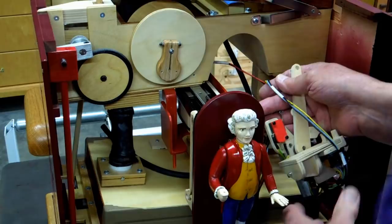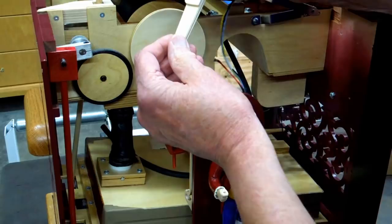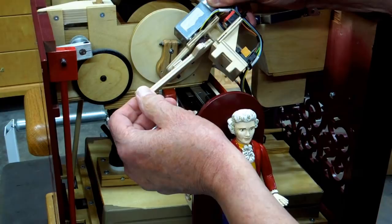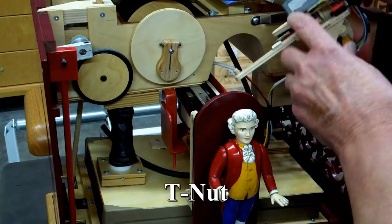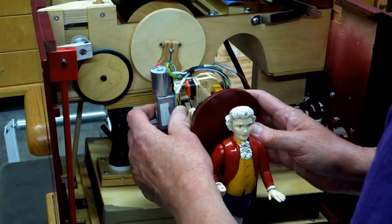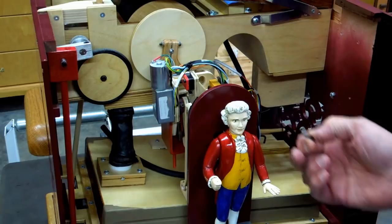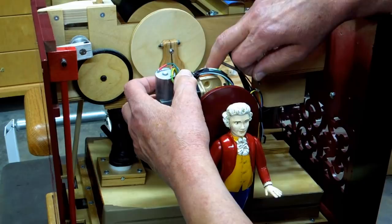The wire comes up here, and you slide this in. This piece, you have to have it at a bit of an angle. It dogs into this slot that it drives. You want to make sure that the set screw is tightened on the motor, and there is a blind nut that has to line up with this hole. Slide that on there, and we move this back until that hole lines up. You can just feel it with your finger. It's fairly difficult to get to, but that holds down on this assembly, and then the sheet metal screw goes into the pressure box.